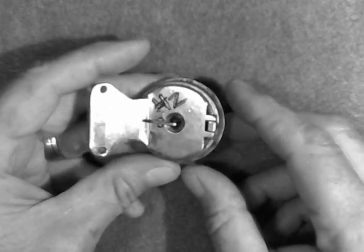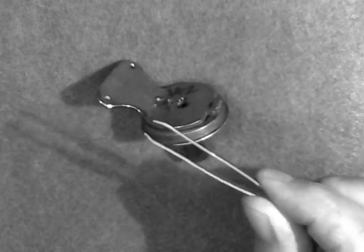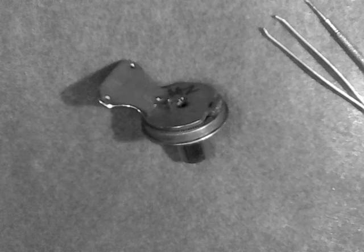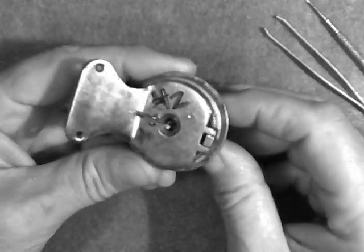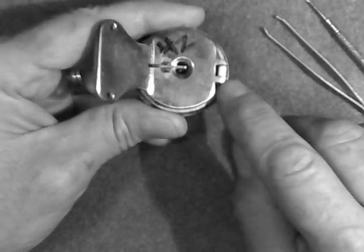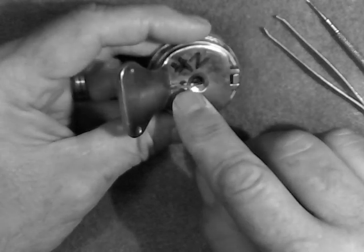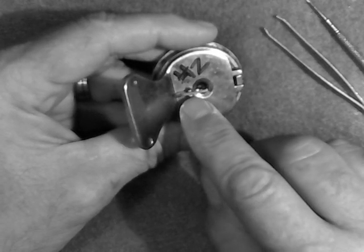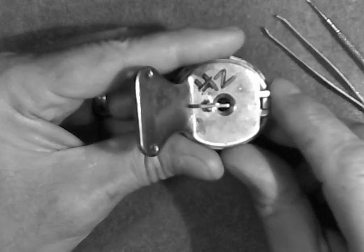It's not difficult, but I have to warn you, you're working with some extremely small parts. So you're going to need a pair of tweezers and you're going to need a jeweler's screwdriver — that's the only two tools you need. There's a screw in the hinge block that is extremely small, about the diameter of a sewing needle and it's threaded. The pin that goes through the stylus is equally small and is in fact a threaded pin — only threaded about four or five turns on the very top near the head; the rest of it is an extremely small pin.